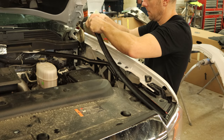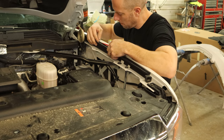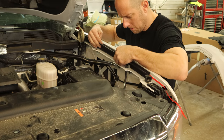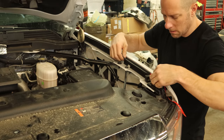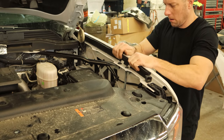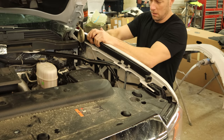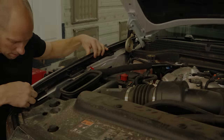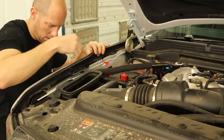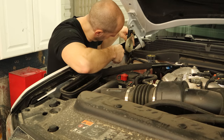I'm going to put our little hood gaskets on — they're just two-sided taped on. Line it all up, pull our two-sided tape off, and stick it to our fender. It's vitally important — actually it's not. If it wasn't in there I don't think anything would happen. Now the passenger side — this one's a little different: clips in at the front, has a tab that keeps it lined up in the center, and this one sticks to the bottom instead of the side. One was designed on a Tuesday, one was designed on a Thursday.